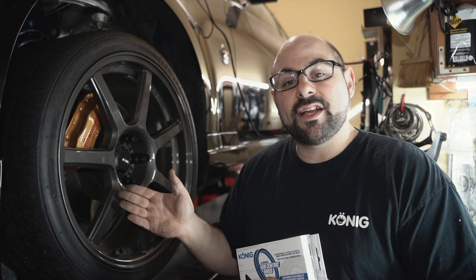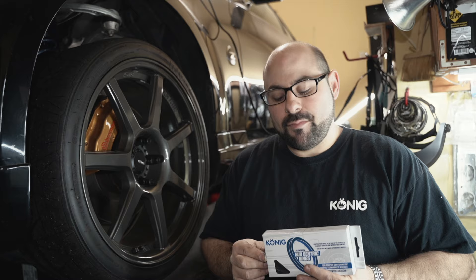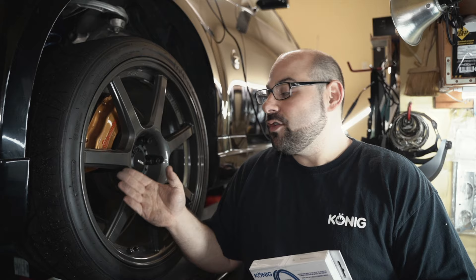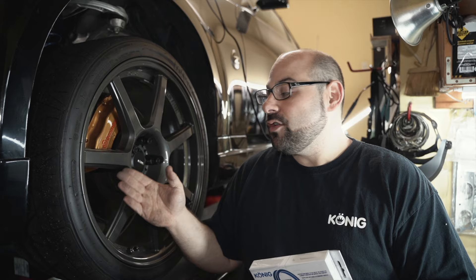Now we're going to talk about aluminum hub rings. The process isn't really that much different, but there are a few steps to make it smoother. We recommend plastic hub rings, and that didn't change just because we made these hub rings. A very small percentage of people are going to require aluminum hub rings — most of those people are going to be in motorsport where they experience very high braking temperatures, or somebody who takes off their wheels frequently, since a plastic hub ring over time will show wear when hitting against the hub.